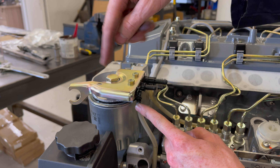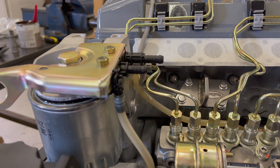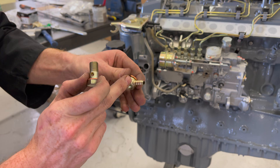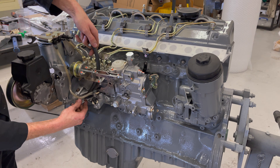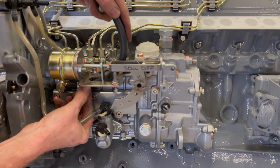That's going to pressurize the fuel filter head. The next point is this one here — the outlet of the filter head that then goes into the injector pump. What you would take is an open banjo bolt and screw that into your injector pump. We supply these banjos with the pumps; the only time it may not come with a pump is if we've completely run out, which is quite rare. Then you take a length of hose — this is the only piece of pipework you need to make, as long as you don't chop the pipes off before you've had a chance to put this together.